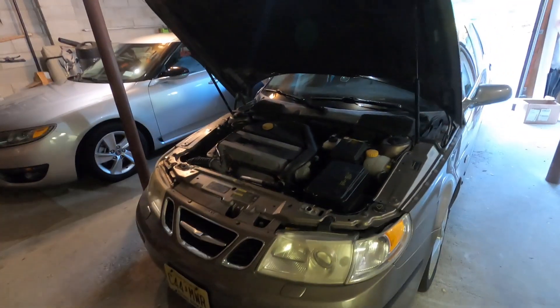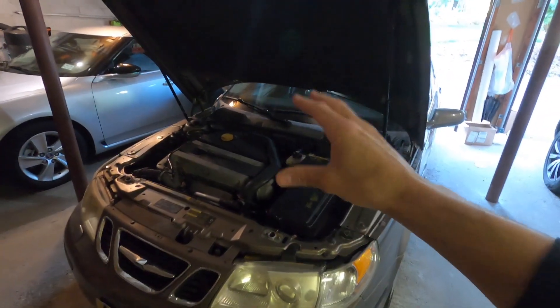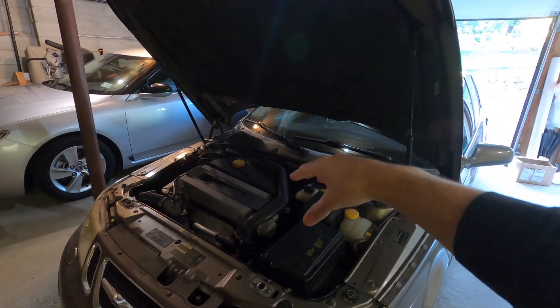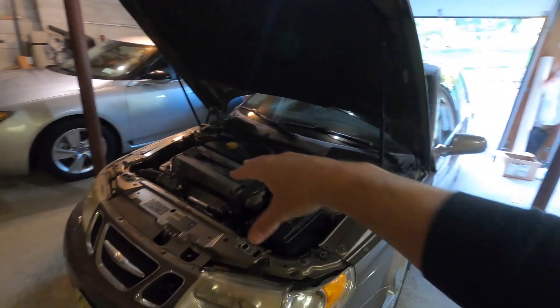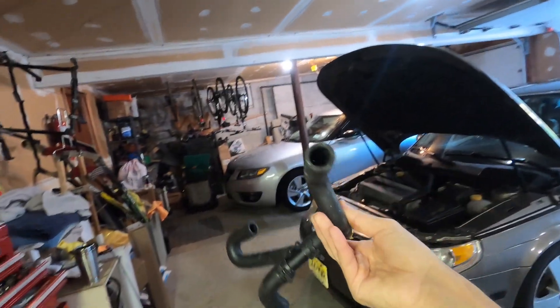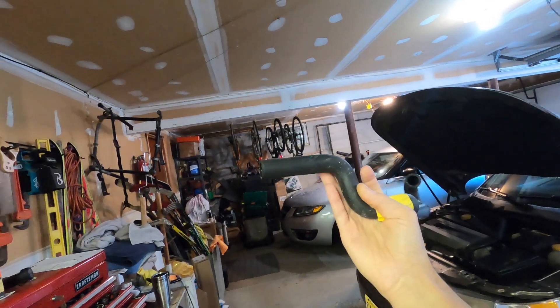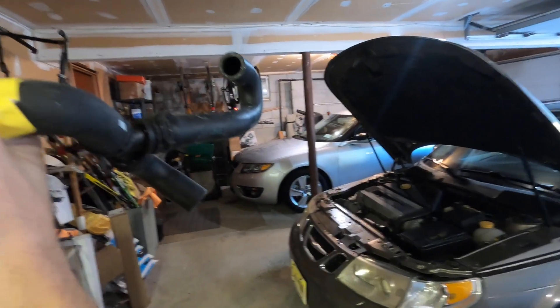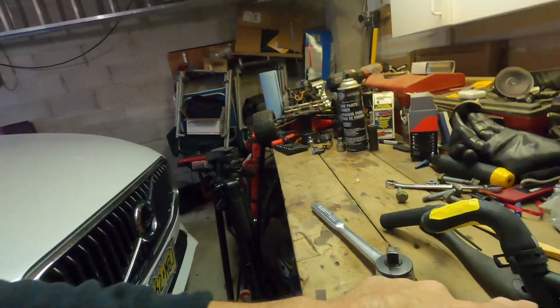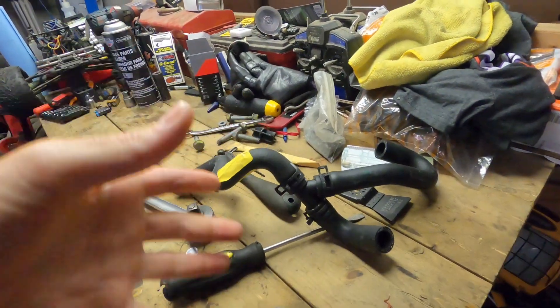It's happening in the back of the engine underneath the bypass valve, and it is the hose assembly. If anybody's ever seen it, you'll know what I'm talking about. I'm about to show you right now — it connects the system to the heater core into the dash, then into the engine and then into the bypass. So obviously you're bypassing that area if you're using your heat or not. It looks like it's leaking very slowly right here on the joint, so maybe the plastic is worn out or maybe one of the hoses are leaking. For a hundred and something dollars, I just decided to get all of it brand new so I don't play any guessing games.